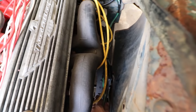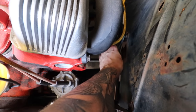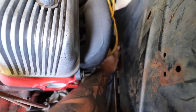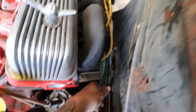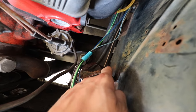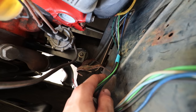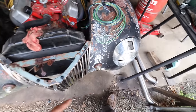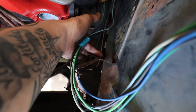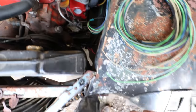We've got the wiring figured out - how we're going to run it. These two plugs for the headlights and turn signals are going to end up right around the brake line splitter, away from the exhaust. There's probably four or five inches between the exhaust, down against the frame rail. We're going to take this bracket off and put a little zip tie holder in that hole. I put a little tape right here on the harness so we know where to place the zip tie holder, so we can start routing everything up through this hole and then across the front end.